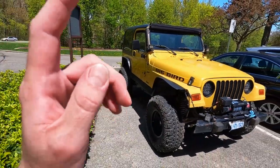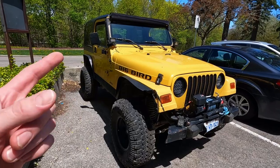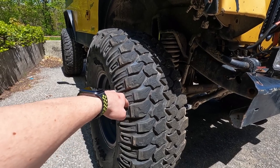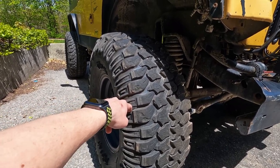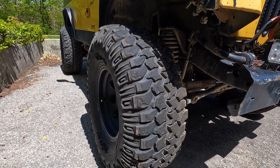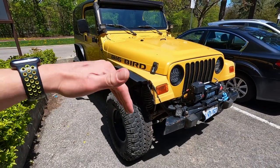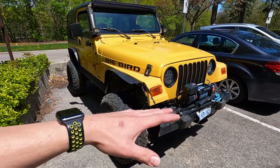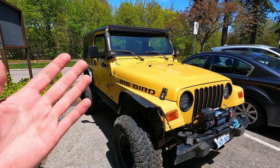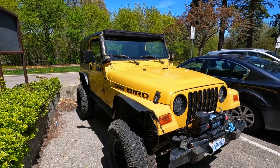I will be putting a new engine in it so it is not over yet. If you guys have been following the channel, I'll give you more of an update on the TJ later. We hydrolocked this thing in about two feet of water — maybe this deep on the tire. Shit happens, I went too fast, I learned my lesson. I obviously made enough of a wake that it splashed up into the intake. I don't plan on doing that again, but accidents happen. Sometimes when you're entering a mud hole it's deeper than you think, or there's a drop halfway through. So just to have some insurance, that's why we got the snorkel for the JT.